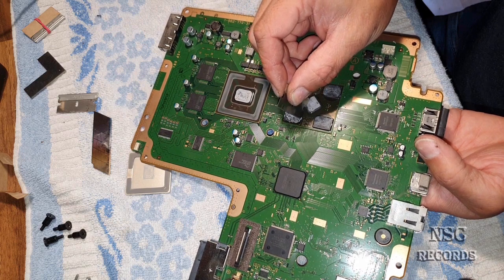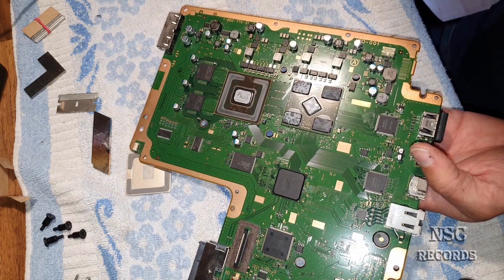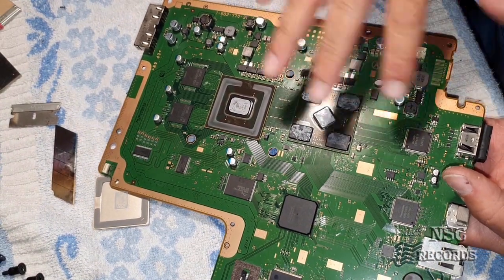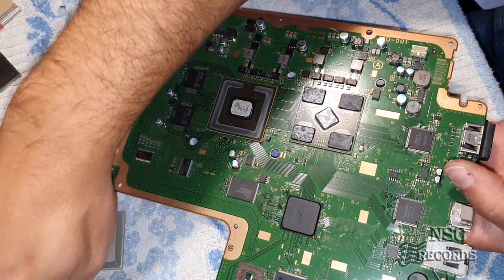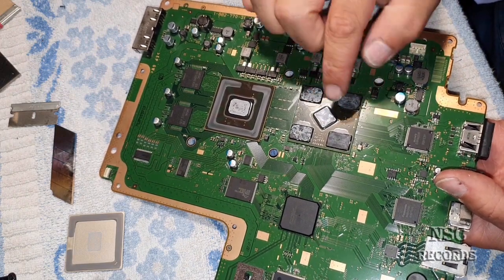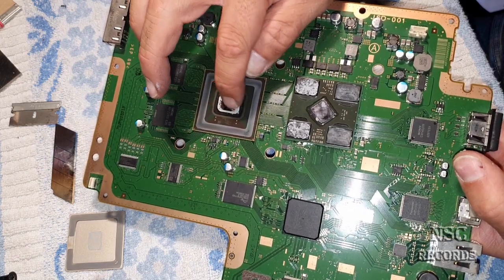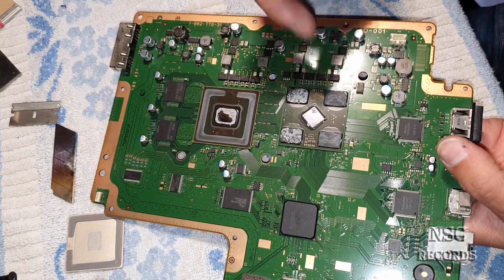With time, the PlayStations run hot inside. They're going to lose the thermal paste inside, and then it's game over for you guys. That's why you're going to need to remove the heat spreaders one day. I don't know which day it will be, but one day your PlayStation is going to run so hot that you need so much fan speed and it's still going to overheat, because the thermal paste inside is just not there, just like here, okay? And thermal paste inside with time will get corrupted, and then you're going to have these problems, okay? I just wanted to tell you that, so that you guys know